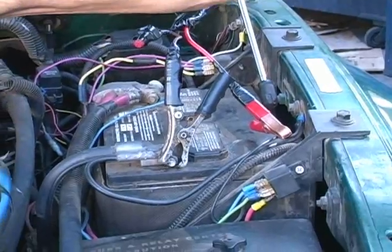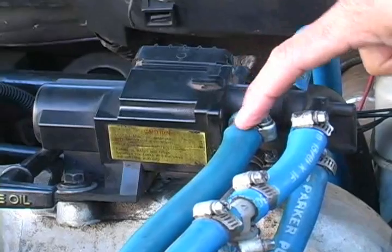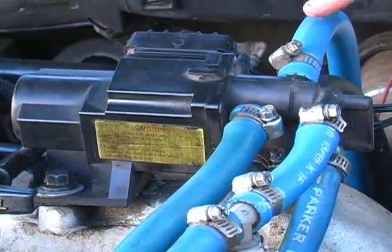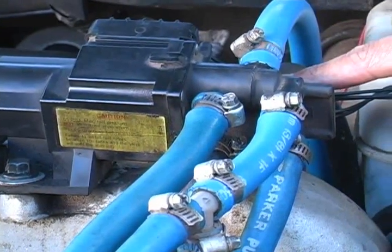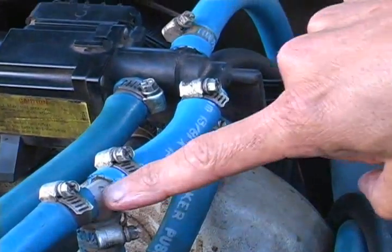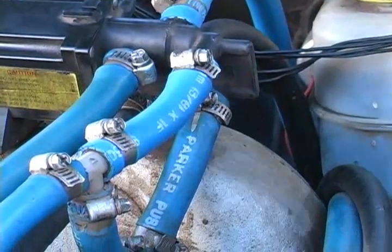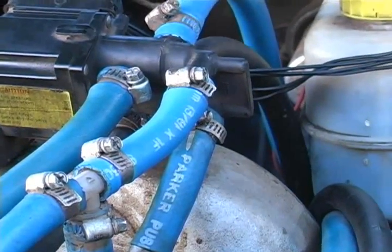Up here is where the engine coolant is coming in and dropping down into a heat exchanger that's down inside the tank. This is the fuel selector switch on my truck. Basically when we're driving around, this is diesel, this is veggie oil — this goes to the motor, this comes back from the motor. When we're on veggie oil, I've just done a loop and looped the fuel back in that didn't get used, because it's now nice and hot. This is kind of the heart of the little fuel selector thing.